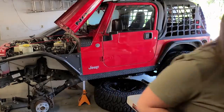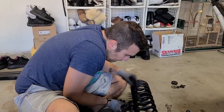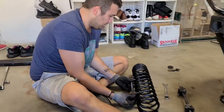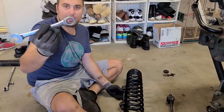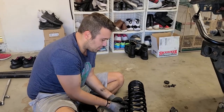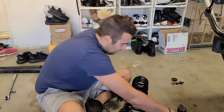Coil compressor time. So I really don't like using these. They make me nervous. You're supposed to use a hand tool to tighten these down. It's a 3/4 inch. I found it really handy to have one of these with the ratcheting ends because it's gonna make it really easy to use once you're in place. Now you want one on either end. Put the locking tabs in place, one on each side here,